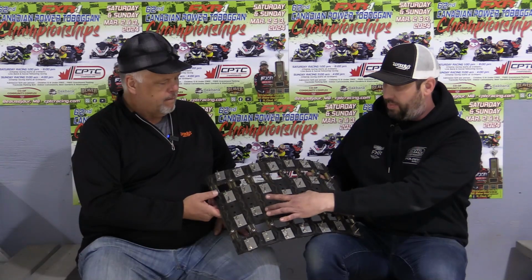Well, there's a gauge that you can buy from Woody's that will go on top of the track lug, and it'll basically just show the height, to make sure that they pass that. And that's something that tech inspection does at the end of the race? Yes. So if you're fortunate enough to go to tech at the end of the race, that's pretty much every time they're going to check that, because it's that important that these are the right length.